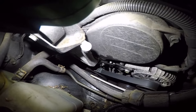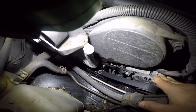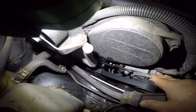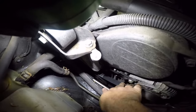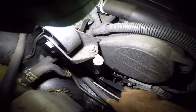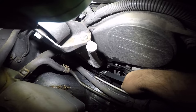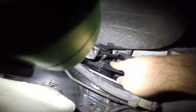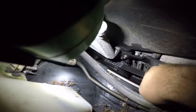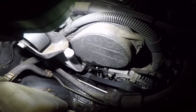Every time we put a lot of things on, what this is doing is putting load on the alternator. The alternator goes under load and the belt is loose - in this case you can see that belt is way too loose. So we're going to tighten this belt up. If you have this issue, make sure you look at the belt. Even though we're going to tighten this up - because these are new belts, we can still see the numbers on it - we want to check the condition of it.